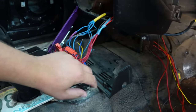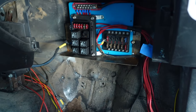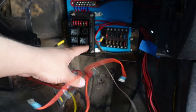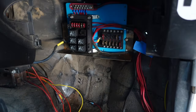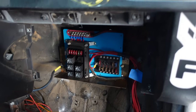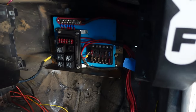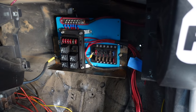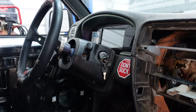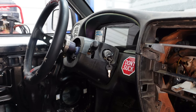Right here is the old switch panel for the truck, and this is the relay box, the fuses, and this is a fuse breakout. So we've got to take all this, wire everything up. There's a few wires here that go to the switch panel. All our sensors have to go on there. Everything that needs 12 volts has to get it from here — our taillights, our headlights, all that stuff. We're not running blinkers. The ECU and everything has to get power from here, so we have to figure all that out.